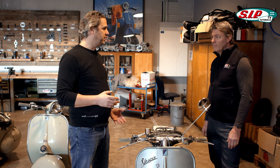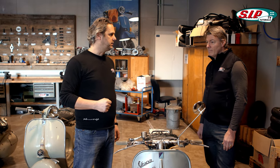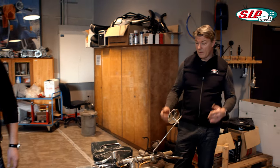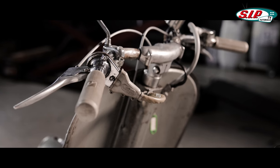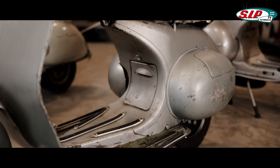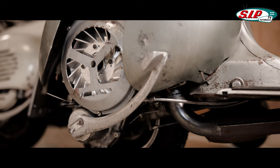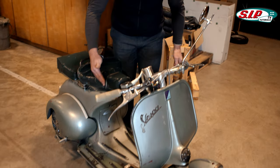How do you recognize a Vespa Wideframe? In 1946 the term 'Wideframe' didn't exist — there was just the Vespa. The typical features are mainly tubular handlebars, a carburetor flap in the frame, and the engine and engine swing arm were still separate. It was later referred to as Wideframe because the frame was much wider than on the following models built years later.